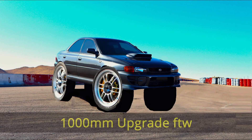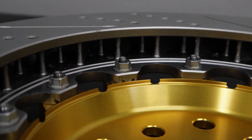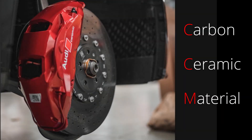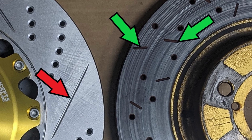With rotors, bigger is better within the braking system, but too big can negatively affect the rest of the vehicle. The weight of the rotor can be reduced by changing the materials — mine have aluminum hats, but some change the rotor material itself to a carbon-based material. There is a wide range in terms of use and cost, and finding that balance is really up to you. In terms of design, I think everyone agrees that slots help by refreshing the pad surface, which results in consistent bite and pedal feel. I prefer staggered short slots over long continuous slots for structural reasons.